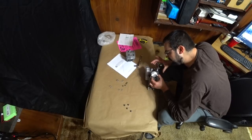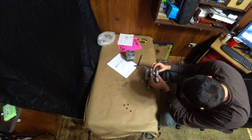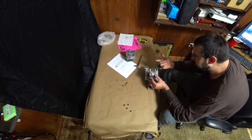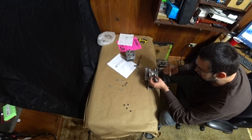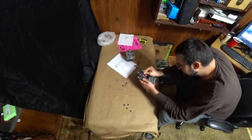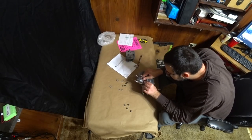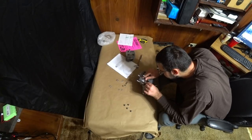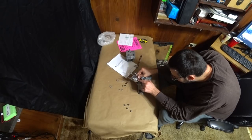Okay. The pins are on the intake side. The cylinder has lubricant on it. The arrow, for whatever it's worth, is pointing towards the exhaust. This clip looks good. This clip looks kind of iffy. Doesn't look like it's quite seated all the way on the bottom. Well, I pushed it down with my finger and the top one popped up.